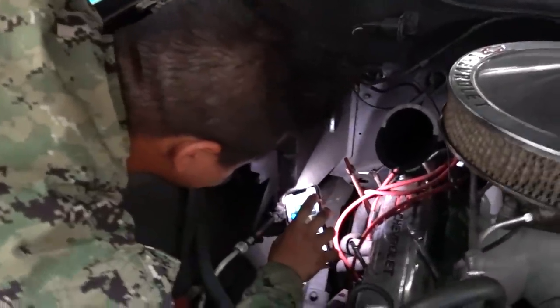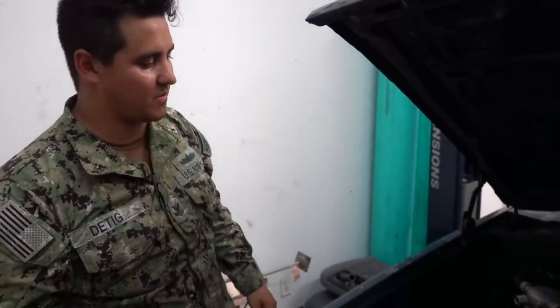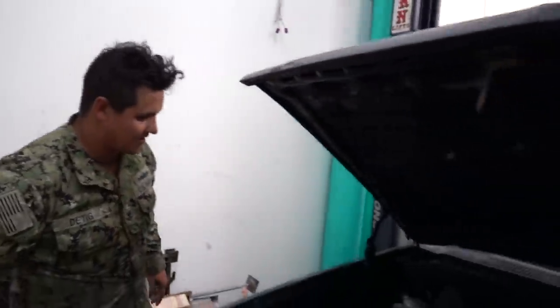Is it spewing out? Yeah, a little bit. How much should we put in? RPO. 10 quarts? Eight. No, I think it's because the sump is full, but since my torque converter is completely empty, that's probably why it's overfilling. So we should have filled it up halfway, started it, let the torque converter fill up, and then redid it. You got any more left? No. Oh, all right. It's close enough. Burnout time it is.